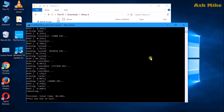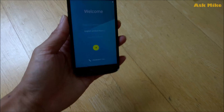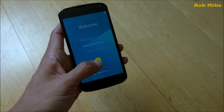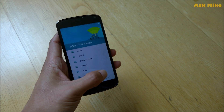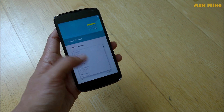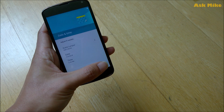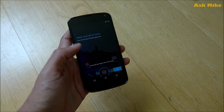Once you see this, we are done flashing the ROM. We basically now move on to the phone for the rest of the setup. The phone is now booted up for the first time. Normally it'll take a while — we just need to wait for the boot to complete. Finally it's booted up. The process takes quite a while, so if you are flashing back to stock, please make sure you wait. I think it's close to 10 minutes of wait time. You can skip through the setup screens and adjust as needed — just go through next and check everything.